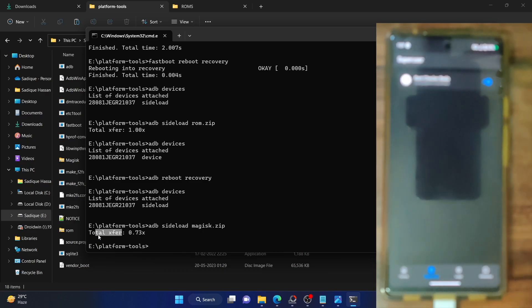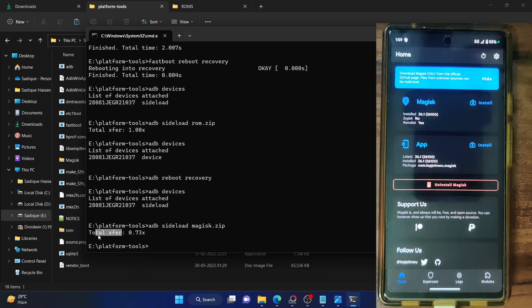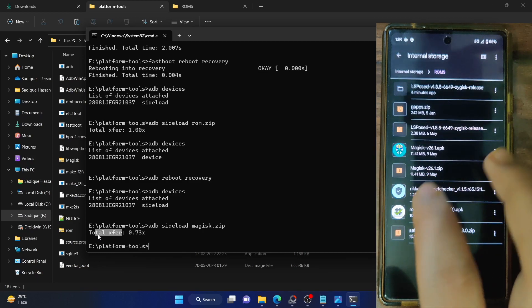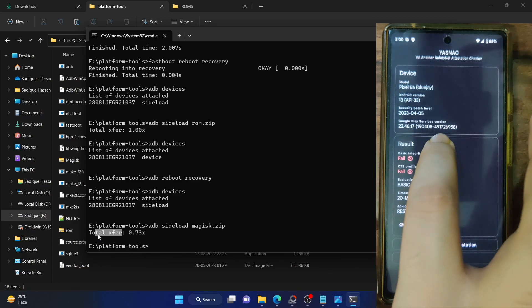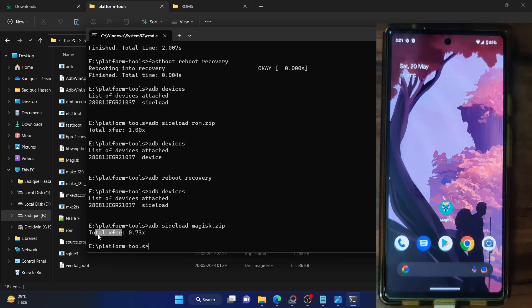In the Magisk app's user section, you can see the Root Checker app has been granted the Magisk prompt. With this we have obtained root. However, once your phone is rooted, the safety net will be tripped and you may not be able to use banking and payment apps. Let's check the status of the safety net — I'll use the YASNAC app from the Play Store. Launch YASNAC, make sure you're online, and tap on run safety net attestation. As of now, we are failing both the basic integrity and CTS profile match tests.